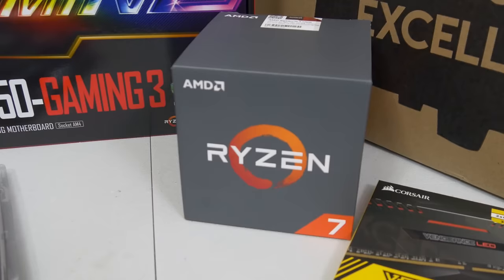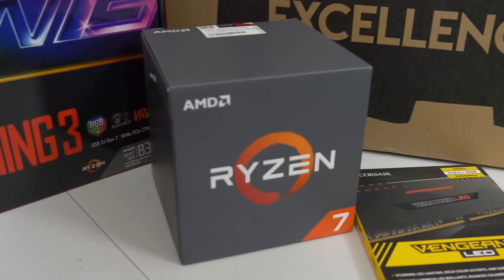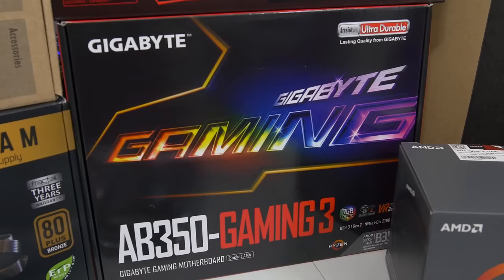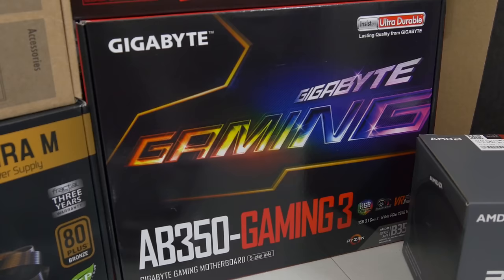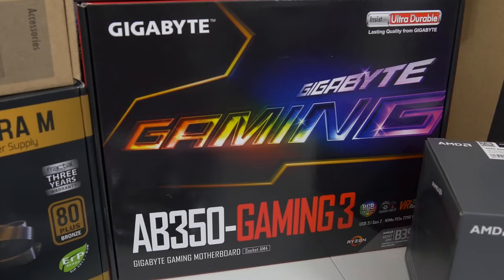Comprising the overall backbone of this PC, we've got the Ryzen 7 1700. I went with this over the 1800X because it's cheaper and you can overclock it and more or less get the same or similar performance as the 1800X. That's going to be on the AB350 Gaming 3 motherboard from Gigabyte. Even though it's a B350 chipset motherboard, it's still going to be enough for our needs since we're only using one graphics card and we don't have a ton of IO. B350 is going to be just fine — plus it's black and red, just like AMD colors.